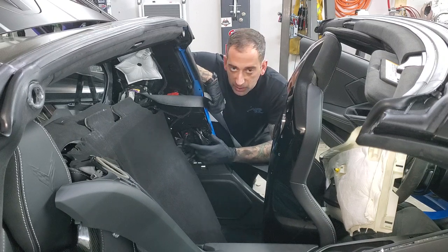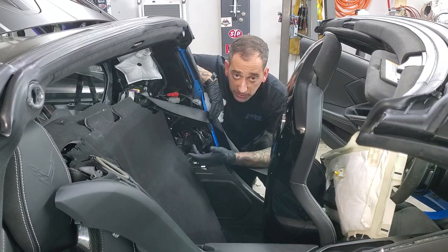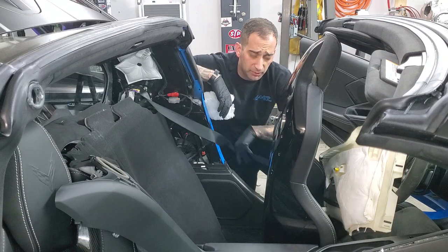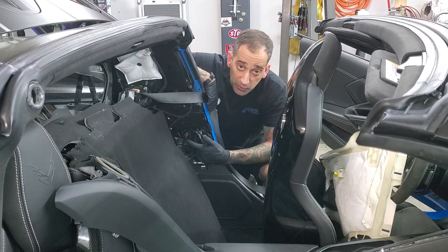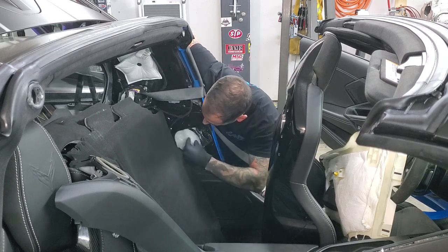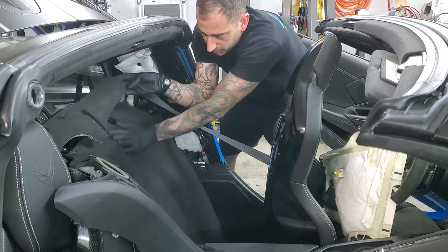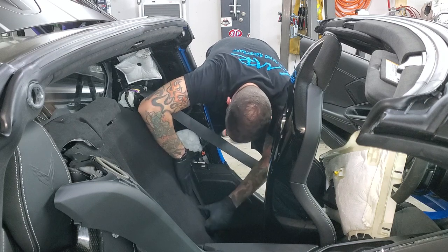Now I'm going to show you how to get this all back together. If you are going to run wires through here, again do this all at your own risk — please be careful. If you want to get yourself a little extra room in there, you can take the latch out. If you're going to disconnect something like this, disconnect the battery. You have to pull the manual cable off because there's an emergency release cable and a little electrical connector and a couple clips and it just pops right out, along with three T30 bolts. Once you take this cover off, you might think there's an access passage through there, but there's not — the frame of the car is going to block you off. So it's not going to give you more room to work — you're still going to have to work completely through here.